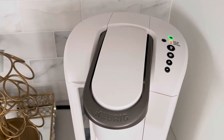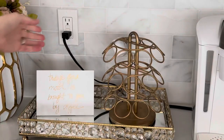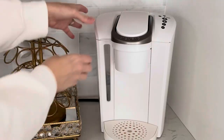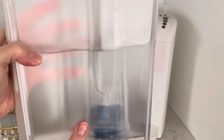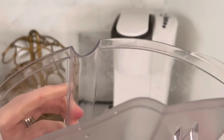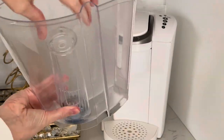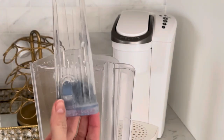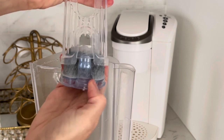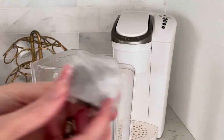You can see that the scale button is on, which indicates it's time to clean it. Turn it off, unplug it — very important — and take out the water reservoir. Dump out any remaining contents in the reservoir. We're also going to be removing the filter. Just pull out the tube and out will come the filter. Push your thumbs on the two little buttons and it will pop and release that filter — go ahead and toss that in the garbage.